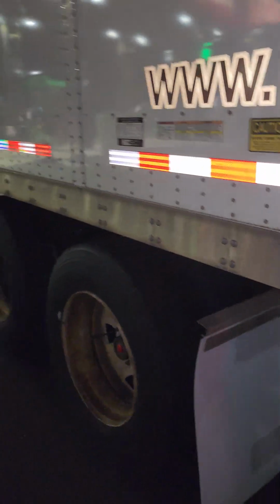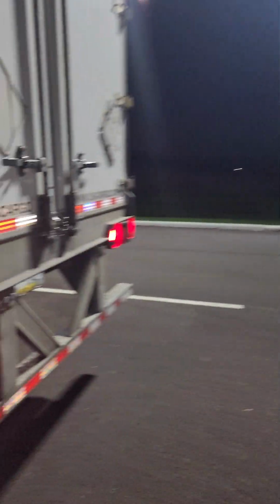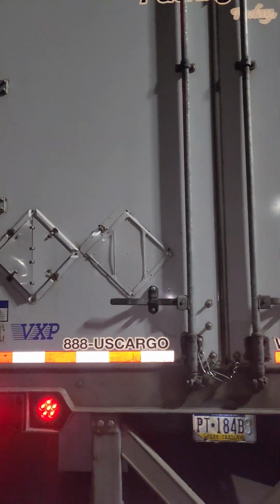We're going to check the tires. Go underneath. Now I found it's easier to inspect cross for the brakes because you can see them more from one side to the other side. Inspecting our airbags, inspecting my ride height. If for any reason your trailer is sitting back, you could have shifted the load. So if you don't have a seal, go ahead and inspect your load to make sure it didn't shift. Make sure all my lights are working.